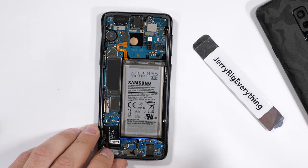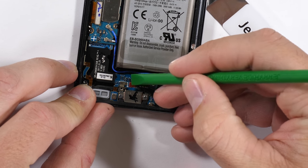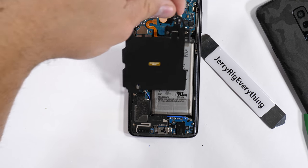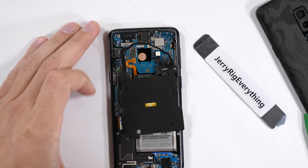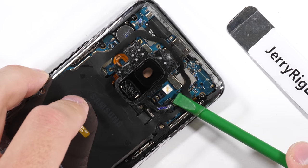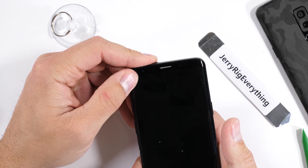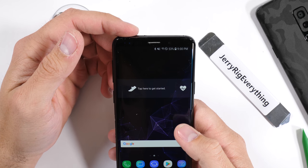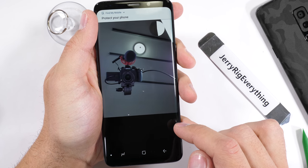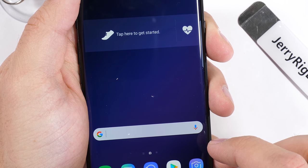The battery is back in place and plugged in, along with the headphone jack and its little screw. I'll get the plastics back on and the 15 screws screwed back into place. I'll use some double-sided tape to hold that glass back panel in place, and after clipping in the fingerprint scanner, I can see if the whole phone works or not. It turns on even without the camera unit in place — it finds Wi-Fi, Bluetooth, and the front camera works. But as soon as I flip it to the rear camera, the camera app dies with a 'camera failed' warning — probably because it just doesn't exist anymore.